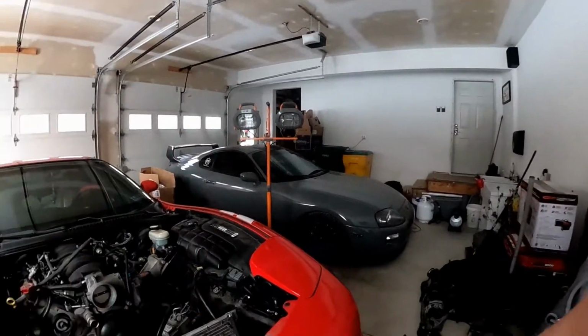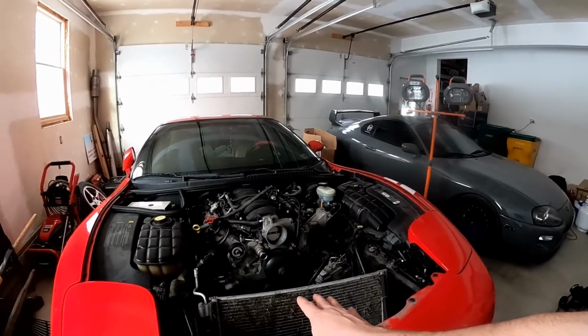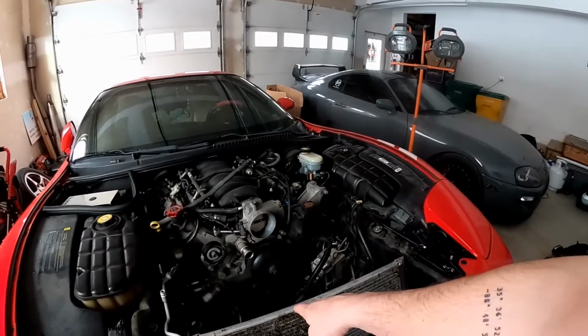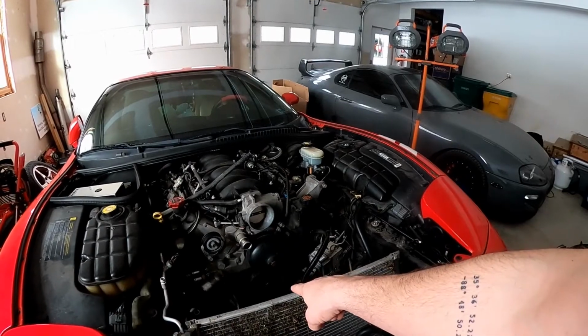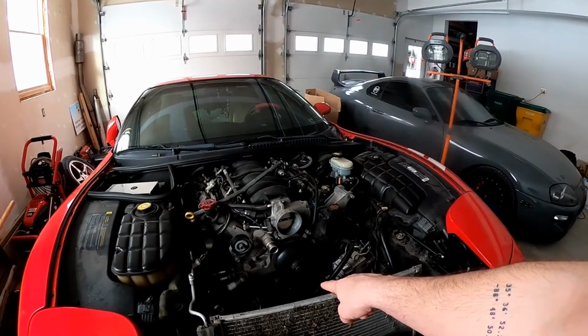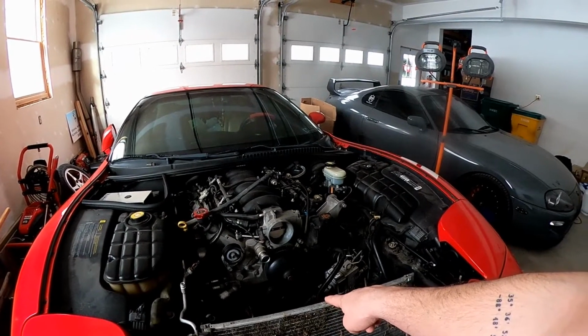Okay, so I started ripping this apart. This is getting a cam, headers, a bunch of other stuff, but I'm waiting on a tool because my 1/2-inch impact can't bust that bolt loose. I'm waiting on this clamp that goes, you take off the starter and it bolts to where the starter bolts and locks into the flywheel, so you can take that bolt off. And I'm gonna need it for torquing it back on anyway. So that's not gonna be here till next week.